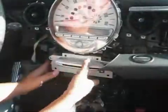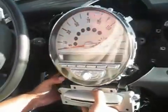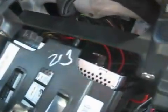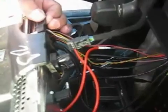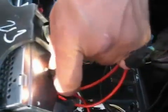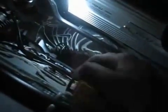Your center console is free. Now pull this out, get all the screws around the odometer, and you should be able to pull this all out in one piece and have access to the back of the odometer. There's just a little pressure tab — push this down and it comes out. To remove the wiring harness for the stereo, you pinch right here, pull this back, and it should just come out with the antenna. There should be a little tab — you push this black part out and pull this out right here. Your airbag is unplugged.